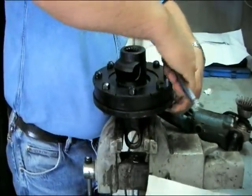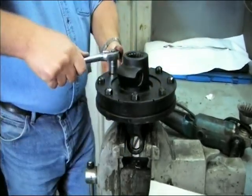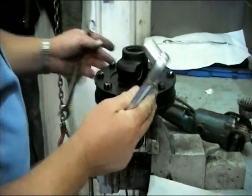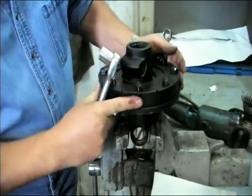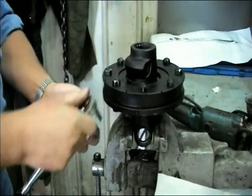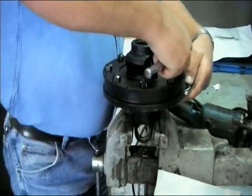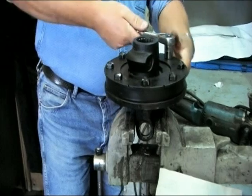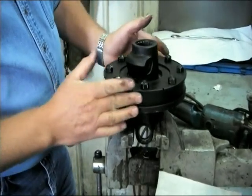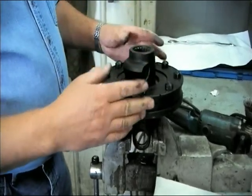I felt that one bottom out, so we've got to back it off a little bit. We're getting real close here now. I can just barely move the indicator ring — I can just turn it. And this is just about exactly where you want it. You can loosen it off just a little bit. It doesn't take very much movement on the bolt to allow the indicator ring to move. This is just a little bit looser than it needs to be, but at this rate, the torque is going to be good on the clutch once it's run in.